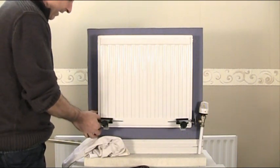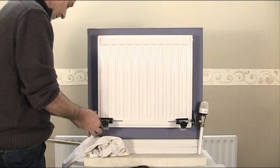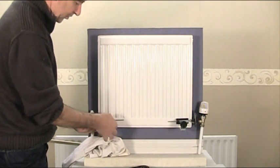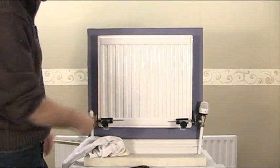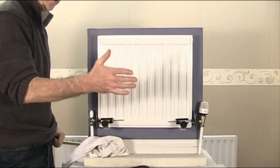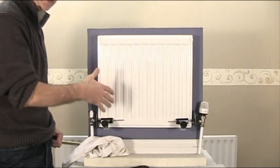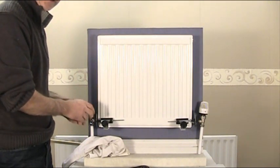Slide the guide rod up to the fork, give it half a turn like that. Push it over that way to stretch it and tighten up the pinch screw there. The radiator is now disconnected — very simple to take it off. Get a couple of blocks of wood on the floor in the corner of your room and just stand it over there, ready for reconnecting. When you reconnect it you can just re-hang it on the wall when you've done your work and reconnect it as quick as you disconnected it.